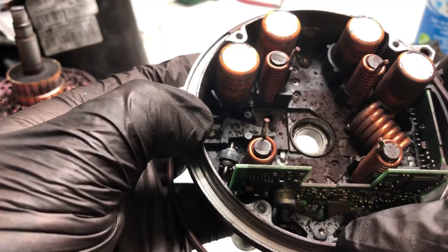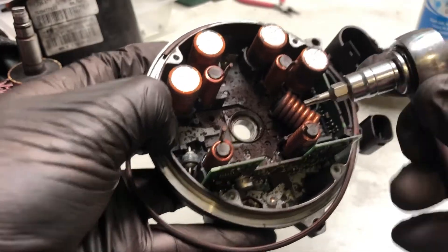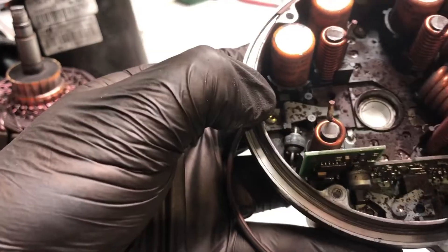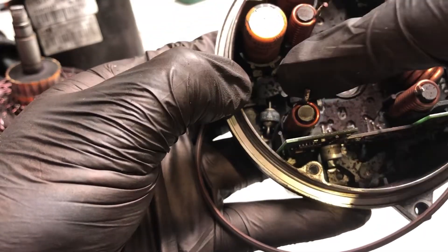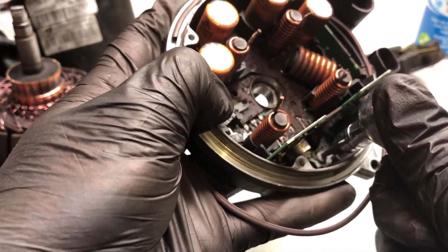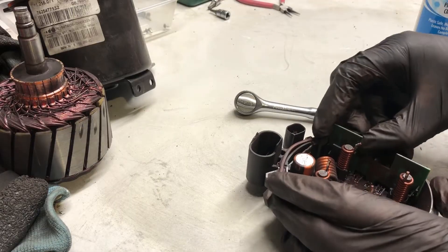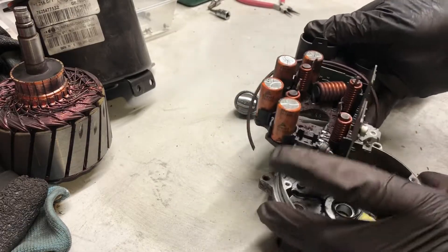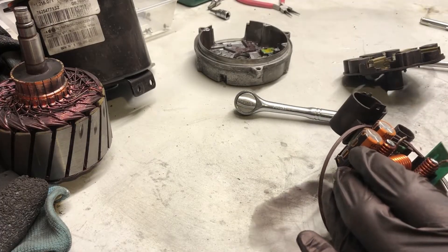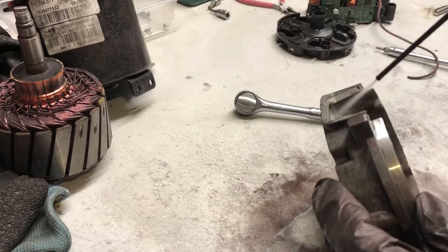What I'm going to do next is take the little Torx screws that hold this base plate in — no doubt there's some muck underneath it. So with the Torx T10 — that's a little one — one, two, three, four screws. Make note because this is like a little bracket that'll come out. There are a few little brackets that'll come apart when you take this out and you'll need to put them back in the same way.